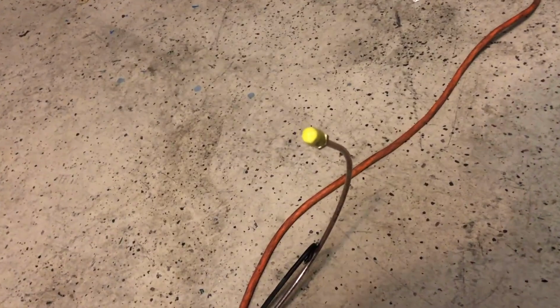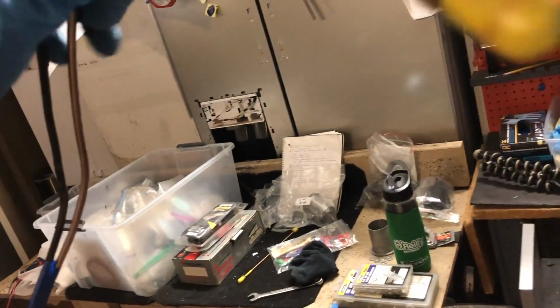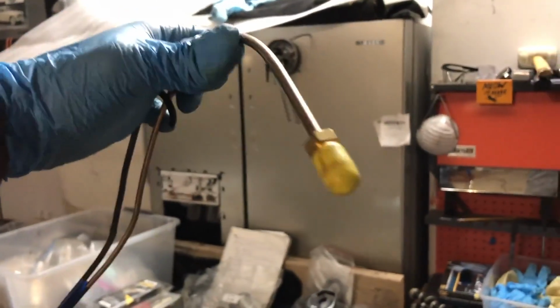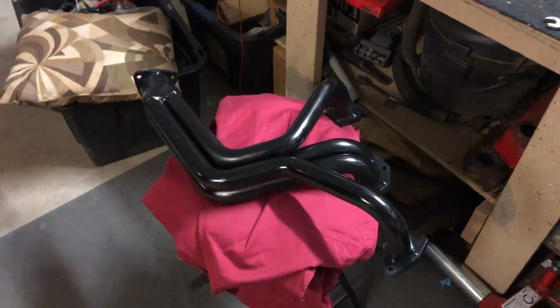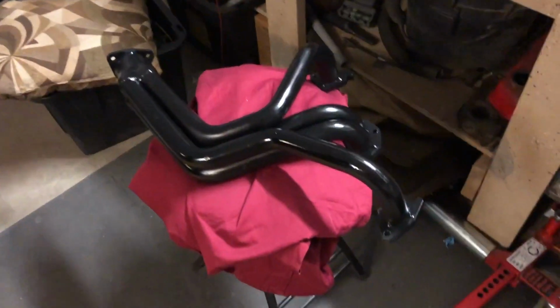Thankfully, there's a lot of room in the back by the prop valve. And these are, I think, bubble flares, and I think a lot of these cars use bubble flare fittings, and bubble flare is not even something you can find in stores anymore. They've just phased it all out, so thank you, BP, for at least going to this effort. I can live with this extra length here. I can figure out how to route it, so I'm not going to complain. I'm actually quite pleased with the quality of their lines. Especially these little parts here that have the part number 672047. Now you know. Also, my 50-cent can of flat gray spray paint came out gloss.